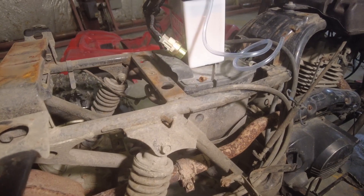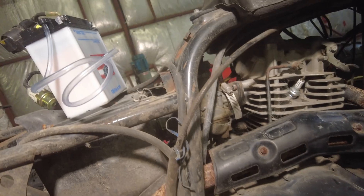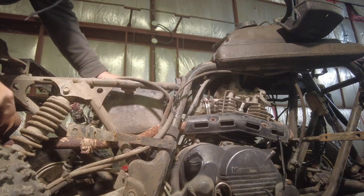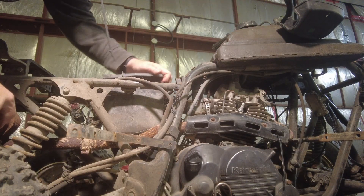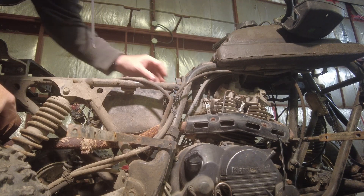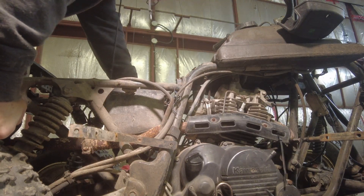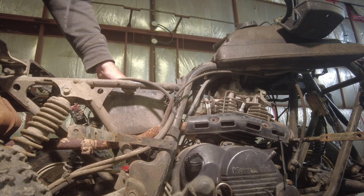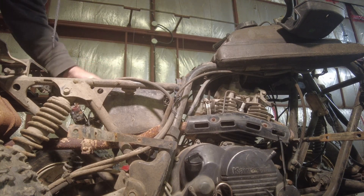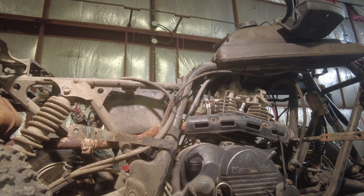The main reason I've taken the back plastics off is that I want to get at the carburetor under here, and it's going to need to be removed and have a little ride in the ultrasonic cleaner. I pretty much guarantee it's going to be all gummed up. We've got our airbox here — the filter doesn't look like it's in too bad a shape. I don't want to lose the clips off of that, as I've only got three and there are supposed to be four. We need a Phillips screwdriver. There are one and two bolts up on the top here that mount the airbox to the chassis, and then there's the boot that attaches it to the carburetor.